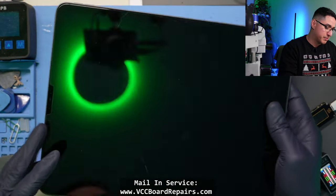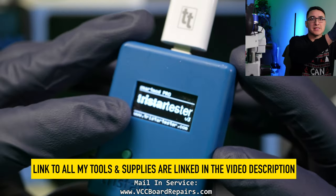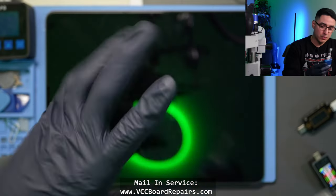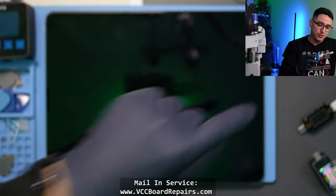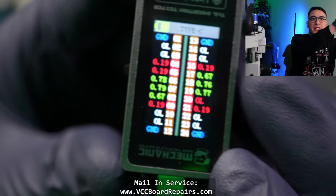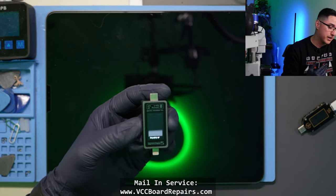A really common question is whether there's a TriStar tester for these iPads. On older iPads with a lightning port, there's a special tool called a TriStar tester that scans the charging port and the TriStar — the charging controller — and tells you which one is bad. It's pretty accurate. However, this does not work with USB-C iPads because USB-C has a completely different circuit — you can't just use an adapter. This mechanic tester just gives you pin readouts and you have to figure out what's good and what's bad, so it's just for reference.